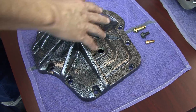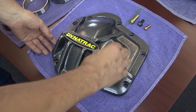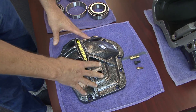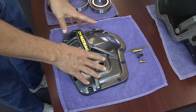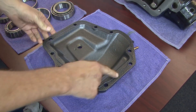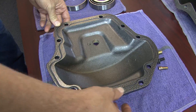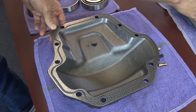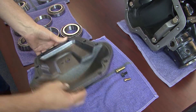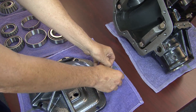The cover is a different shape than our older covers used to be. We've also changed the way that it attaches to the housing. Not only does it have thicker ribs and a stronger structure, but the cover is now an integral part of the housing structure — it's not just a cover to keep oil inside. To do that, we implemented an O-ring sealing method. So now when we clamp down on this cover, we're going to get full metal-to-metal contact between the diff cover and the axle housing face. This allows us to put a lot of clamping force in here, so we really stepped up our game with respect to the cover attachment method.